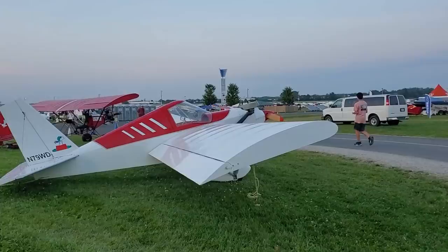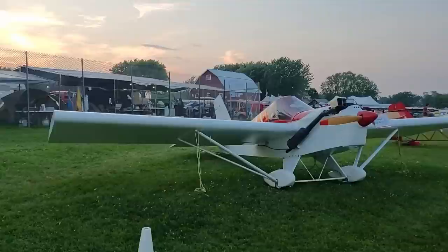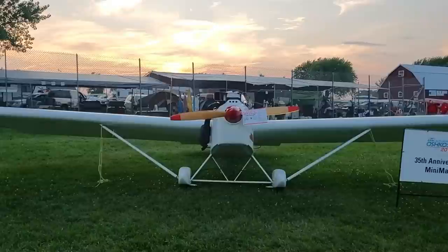If considering purchasing a used Team Mini Max, it is the Ultralight Flyer's recommendation that the plane's fabric be removed from the airframe and wings and that they be thoroughly inspected. Other areas of inspection include the landing gear and control systems. If the history of the engine is unknown, it is recommended that the exhaust be removed and the pistons inspected